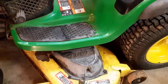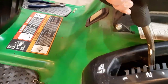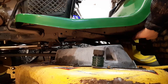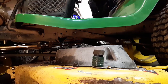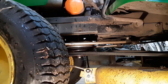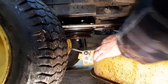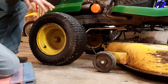Now that I have the pins off on the right-hand side, I want to lower the deck to the floor. So you just come up to the handle here and lower it all the way. Now I can remove those hooks at the back of the mowing deck. Now I'm going to take the belt off. There's a pulley here on top of the deck that you can push forward to loosen the belt. The belt is off, and now all we have to do is remove this. The mowing deck is completely unconnected and I can slide it out.